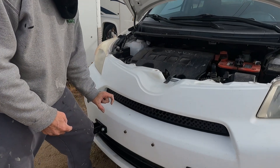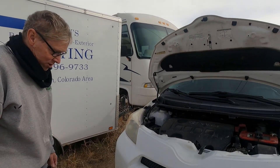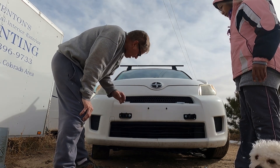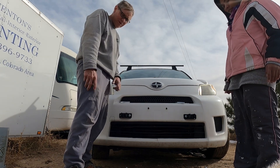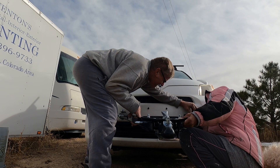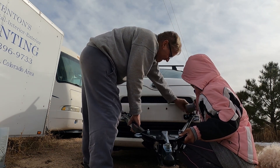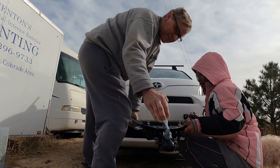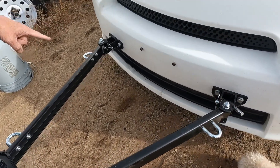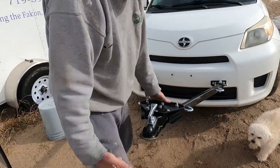When these press, they're going to be pressing on those retainers so it should lock right in. We're going to test it afterwards. This car is a very light car so I'm not concerned. It'll have a safety chain. The brackets mounted great - they're solid, locked in, crushed between those galvanized spacers. We can sit the tow bar up now. Put the pin in, and it's all set. All we need now are the safety chains that go from the tow bar to the motorhome. I think I'm going to mount it to the pulling tab. Not a bad setup for Harbor Freight.